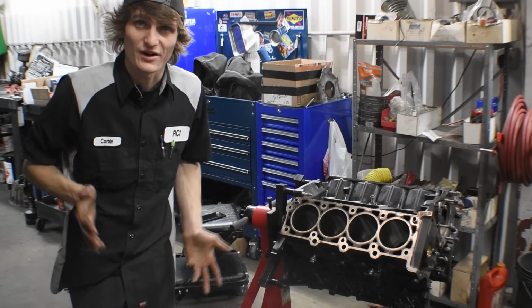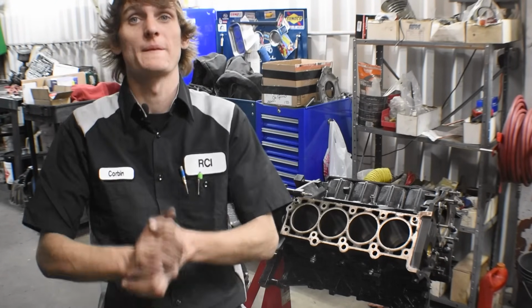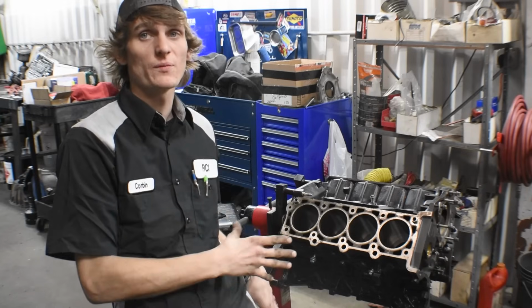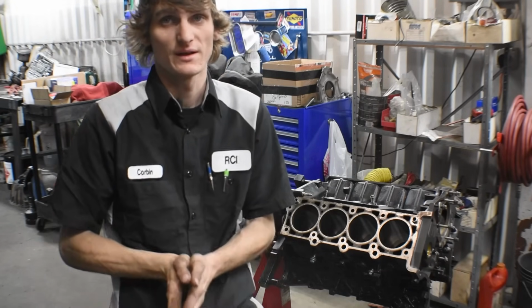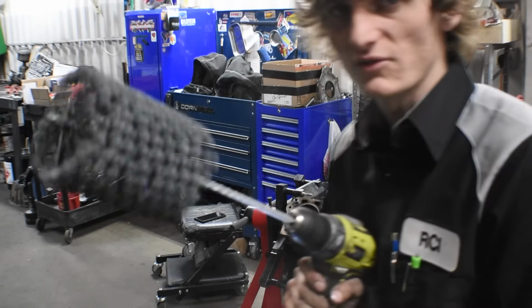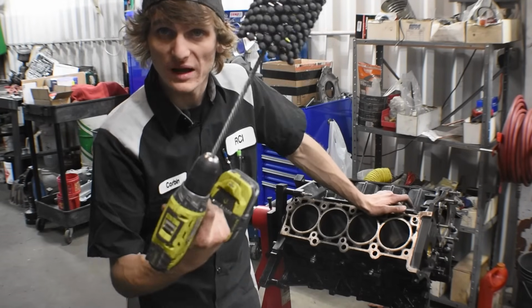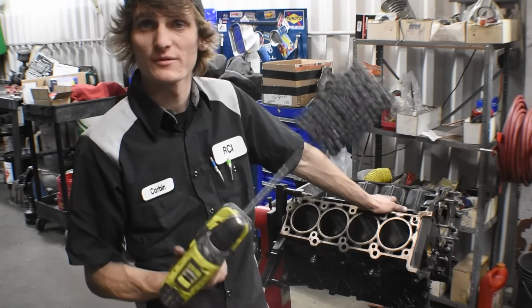It's time to start honing the cylinders. What we're going to do now is the start of this whole thing, and it's very important that you do this every time you rebuild an engine and you've got new rings going in it, anything like that. I've got my trusty dingleberry hone, by Flex Hone. We're not sponsored. That would be cool.